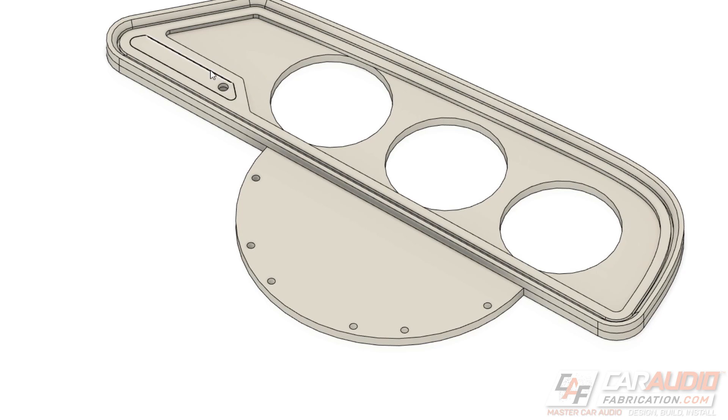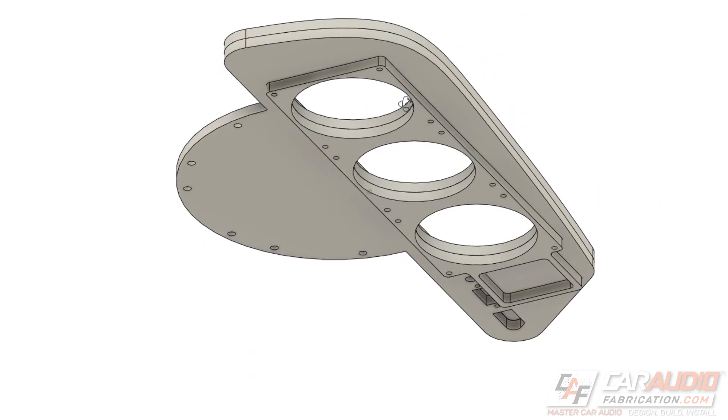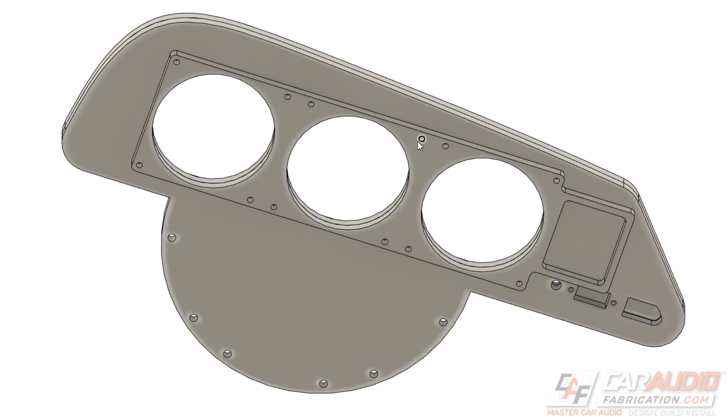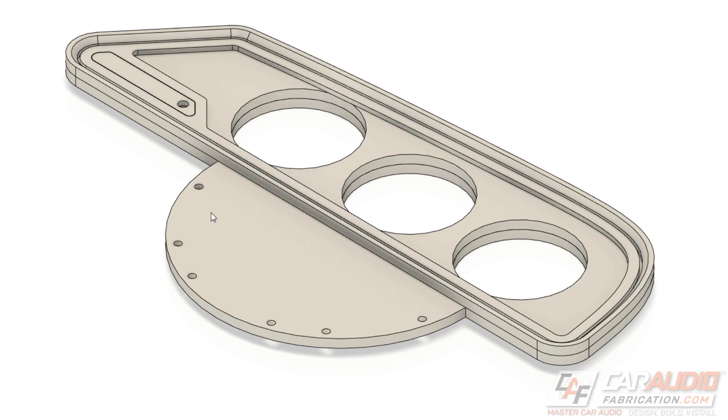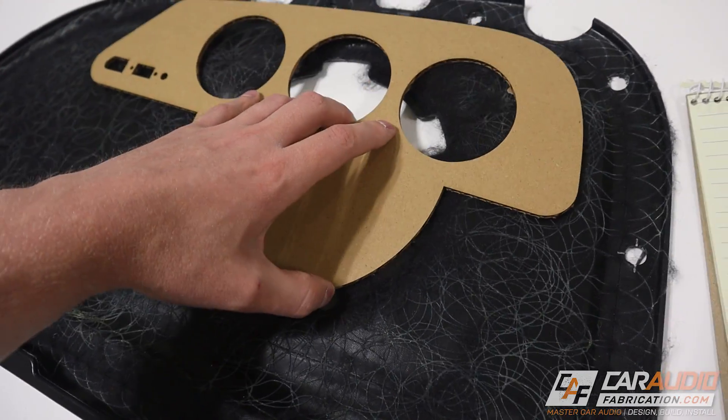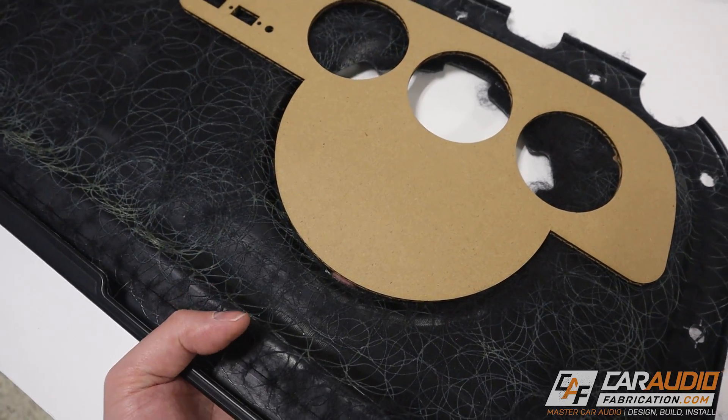On the back side of the panel I've created a fan mounting flange with all the mounting holes for the fans. I'm going to cut these holes at the minor diameter so I can tap threads into the acrylic, and there's also a little spot for a fan controller. All the pieces are going to be made out of acrylic. Since acrylic is a bit more expensive, I want to test out the fitment on the actual OEM panel first by cutting it with cardboard. It definitely looks like the round part is going to match up nicely with that factory subwoofer grille hole.